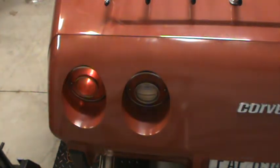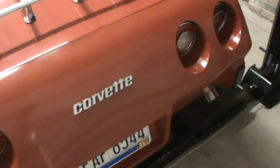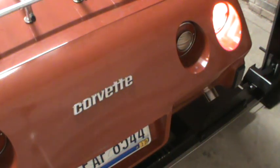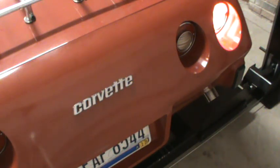on your car. So the driver's side turn signal, all I had to do was take out the bulb and reinsert it, and it seemed to fix it. So that's working. And I'm gonna switch over to the passenger side now, and I'm going to change the turn signal to the other side. And as you can probably see, it blinks, but it blinks pretty slow. So I wasn't happy with that.